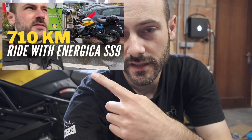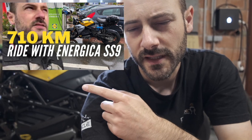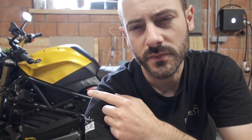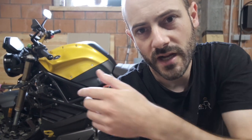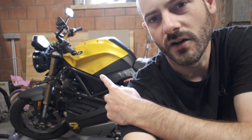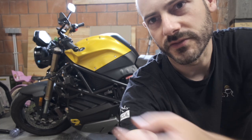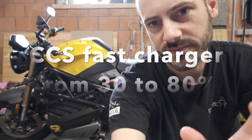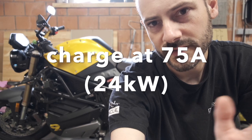I've done it — I'll link a video where I show that I did a one-day ride of 710 kilometers and it only showed me the yellow battery icon once that day, and that was only because I had to go down to 10 percent because all the chargers I encountered were either broken or occupied. The trick is to stay within 30 to 80 percent battery state of charge and charge at 24 kilowatts.